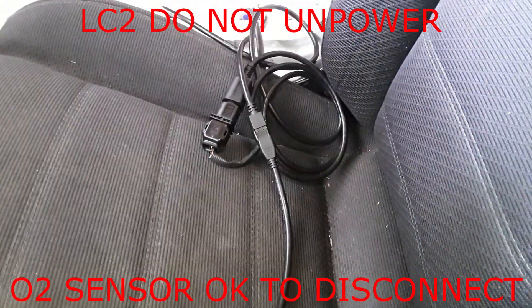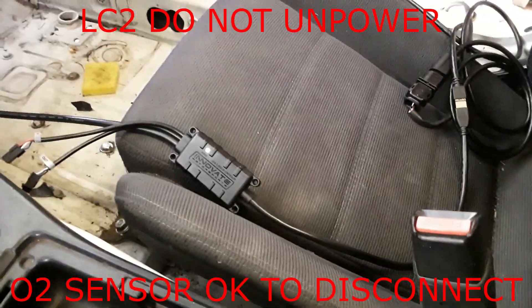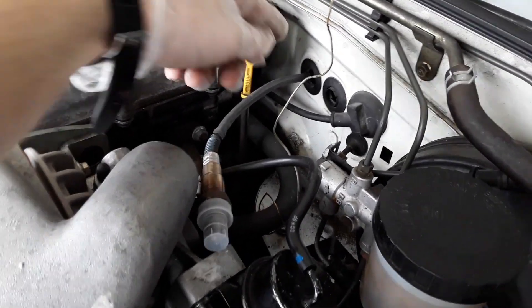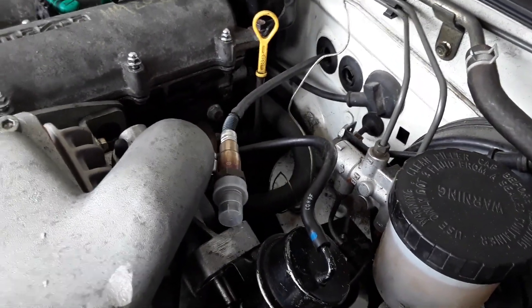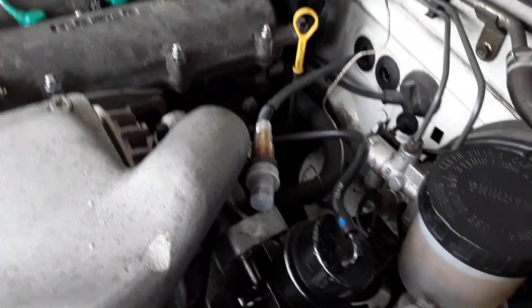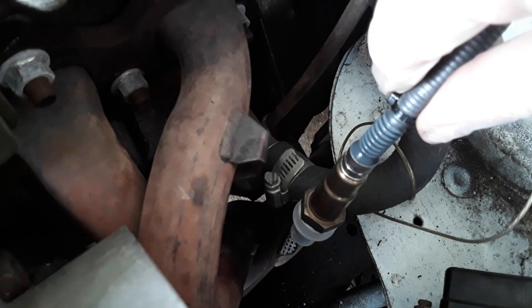Once powered off, you can disconnect the actual O2 sensor — that's okay to do. My Miata has been customized, so I have grommets available to feed things through. I fed the O2 sensor cable through the available grommet. You probably won't have one there, so find something that works for you, but this one stays out of the wheel well. Then the sensor goes back down into the O2 bung, and we're one step closer to having this thing ready.